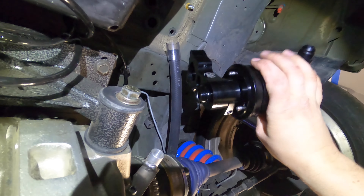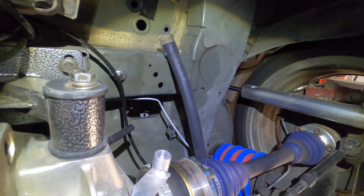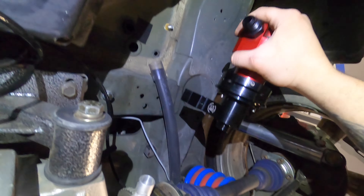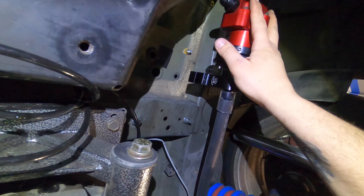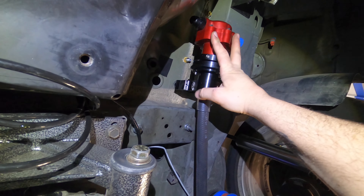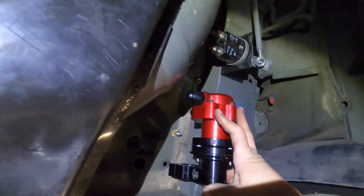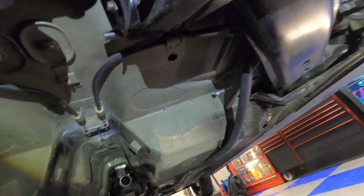Here's the pump with all the bracketry. This is where the fuel tank's going to go, so that's another reason I like it back here — we're super high so I don't have to worry about the pump being close to the ground. It allows the cable to be straight. I could build a little bracket right here to hold the pump — our hose is really straight, really close to where the fuel tank's going to be, tucked up nice and high. Don't have to worry about dragging the road or anything happening there.